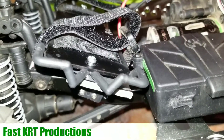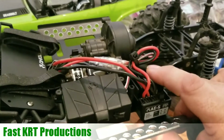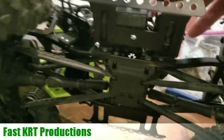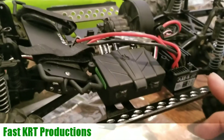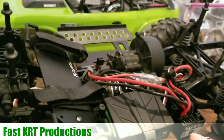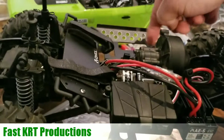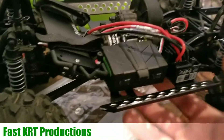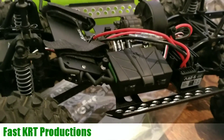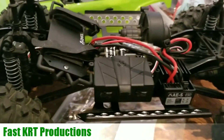We'll take this back apart and paint the aluminum. We zip tied this and double-sided it with gorilla tape - the clear one that holds up to 15 pounds. I actually picked up the whole truck by it. The rock sliders were ten dollars from Amazon, and I got about five dollars worth of parts including the screws and aluminum. You can buy a piece that already fits the SCX10, but you have to use the original rock sliders and they dip down, which is bad for clearance. So I still came out ahead and have the pride of making my own.